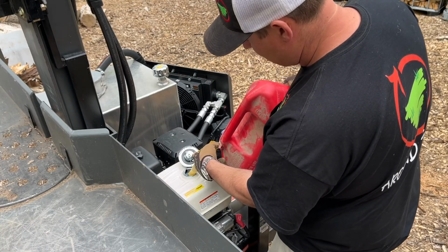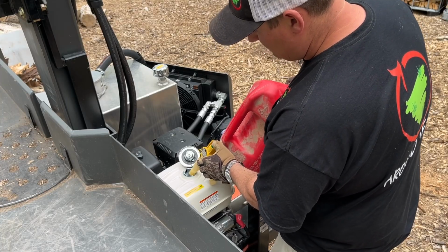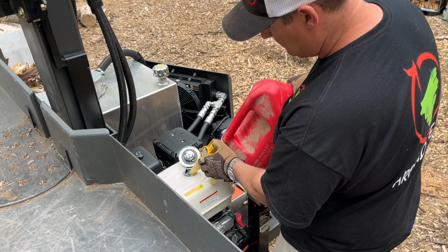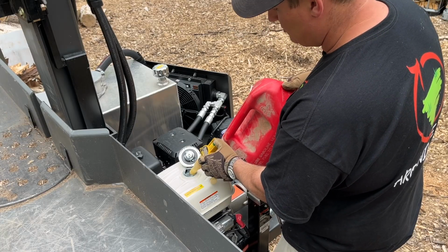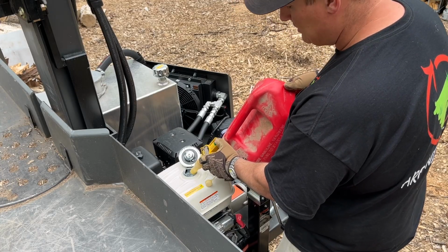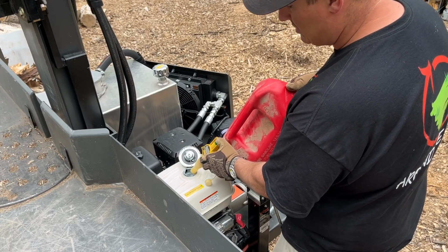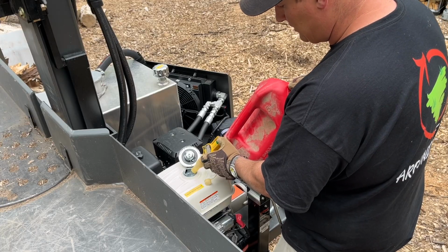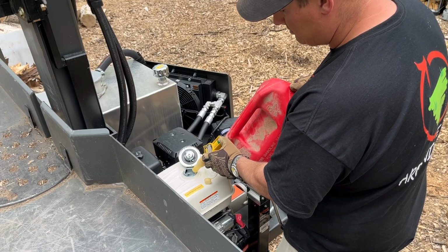And the other thing I do is I use these no-spill gas tanks with the button on them. If you're going to follow the compliance stuff, these are the best I've found. Everything else you have to add a vent to the back to make it work right. These do a pretty good job. They also have one of those heavy filters down inside when you get them. That makes filling them up at the gas station a nightmare, but needle nose pliers get rid of those in a hurry. And then I think they also work a little bit better, but yeah, it lets the fuel breathe in and out.